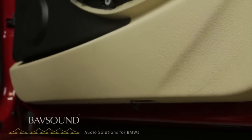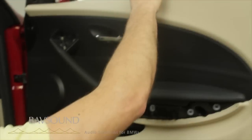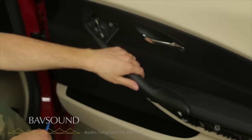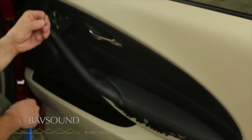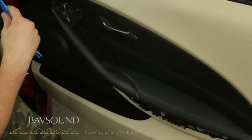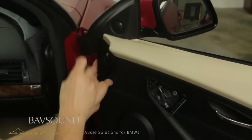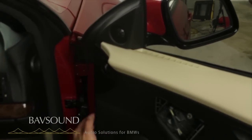That leaves the door ready to come off. The door is secured by a series of clips around the perimeter and across the top — that's how the rest of the panel is secured. These are big heavy door panels, primarily because there is an airbag attached to the panel. Don't let it scare you — we simply remove it and wire-tie the airbag module up onto another harness while we take the door to our workspace. Do not use metal tools on these leather-wrapped doors — you will get scratch marks.